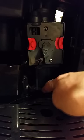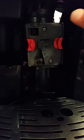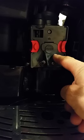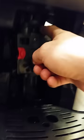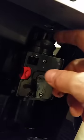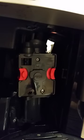It has a low limit sensor. Once it reaches the bottom, it backs off a certain distance and stops. It has a high limit sensor that tells it to stop. And basically, right now, because this is pulled open, it has an opening inside of it. When you remove it, it has compressed to the other settings so you can't see it, but when you grind the fresh coffee, it drops inside of there, then it goes up to the top, and this piece right here actually does the tamping, and it just pushes the grounds into the thing and pumps it right there and spits out the coffee, and then it goes down and it ends up leaving a puck above, and this little arm here pushes it off into this tray. So that's pretty much all there is to this machine.